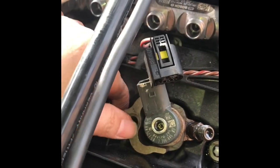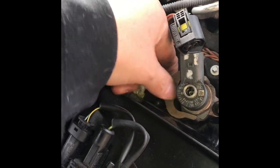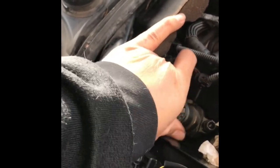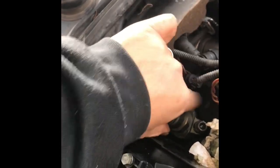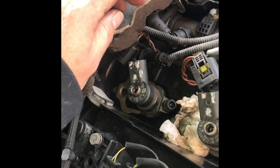All those rails are out now. These can be really, really fiddly - you may have to lift the injector up to try and get them out, plus my hands are covered in diesel. I'd like to keep them in order - they're going to be pretty much the same. I just think it might be a little bit easier to keep everything as we started. That last one's going to be really difficult. Of course it is - nothing's ever easy on cars, is it? I'm going to get it out, don't you worry. What I'm going to do is lever the injector out a little bit to give me a bit more space.